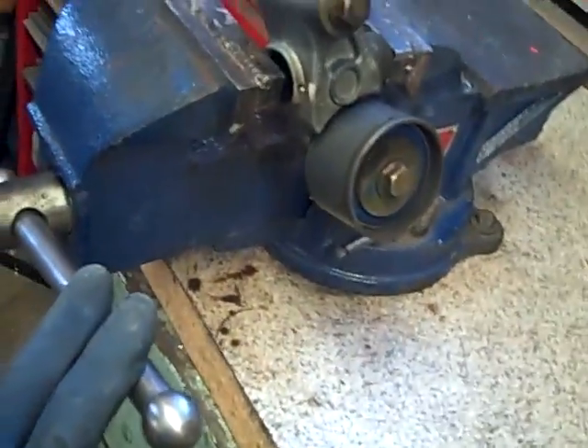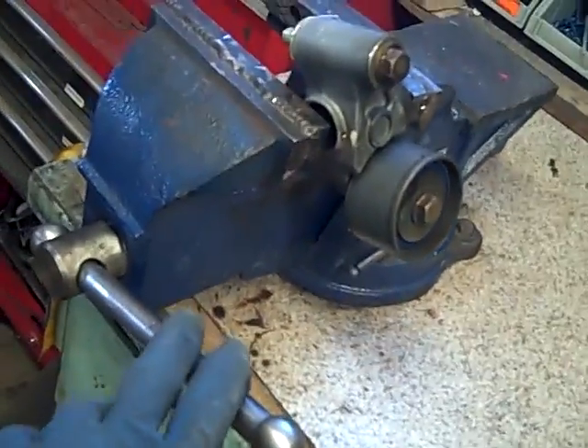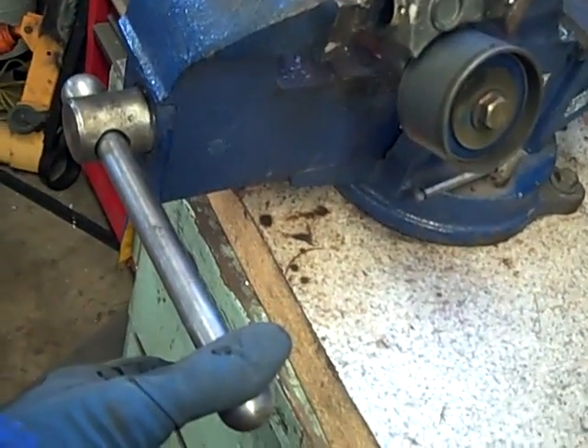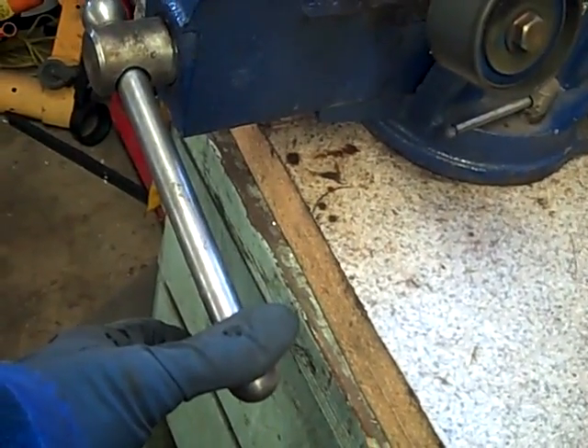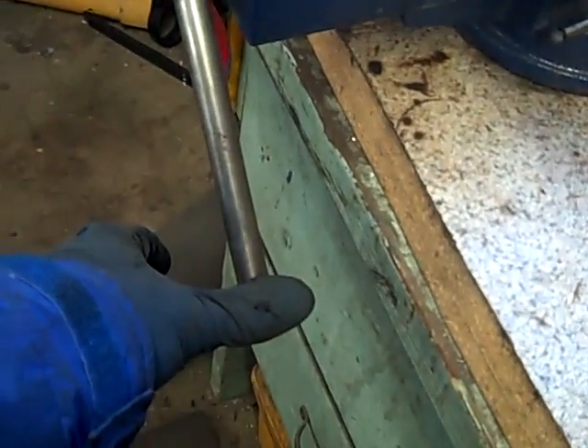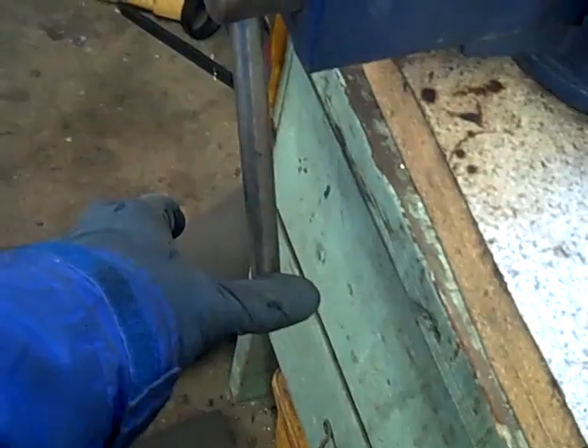What you do is you've got a little hole in the end of the tensioner. I like to call them grenade tensioners because it's like pulling the pin on a grenade. You put them in a vise. You want to go slowly — if you go too fast you'll destroy the tensioner. But if you go at a pace about like this, nice and slow, 90% of the time they're reusable and you're fine.